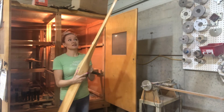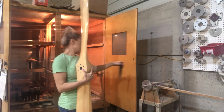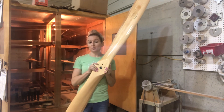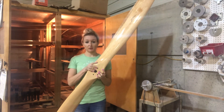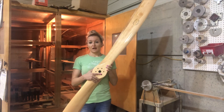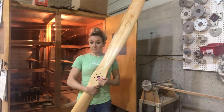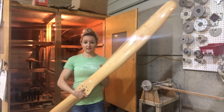Now this is a 90 inch — I don't think I'm going to be able to get it all in the screen — but it is going on a 2276cc VW engine with a 2.47 reduction. What that reduction allows us to do is run a much bigger diameter propeller because it keeps the tip speeds down lower. Tip speed is generally what limits your diameter of propeller, so by using the prop speed reduction unit, it allows us to swing a much bigger prop like this 90 inch.